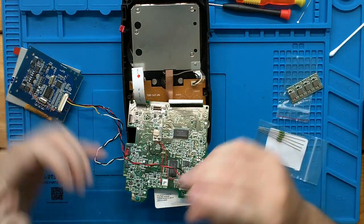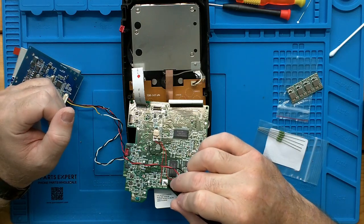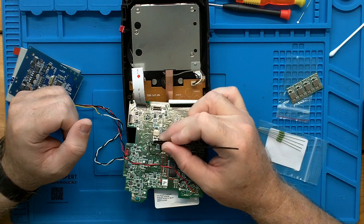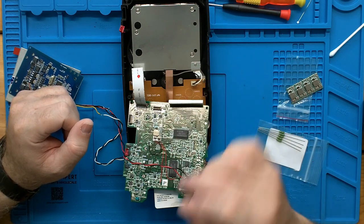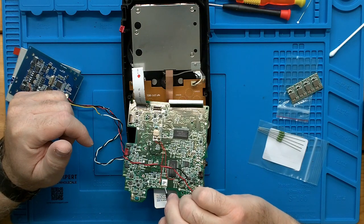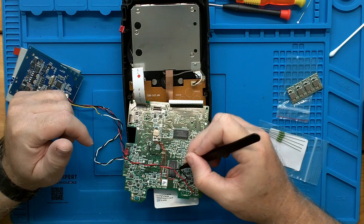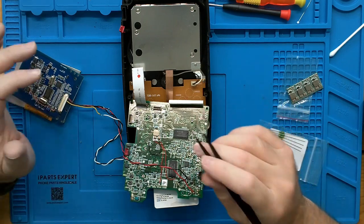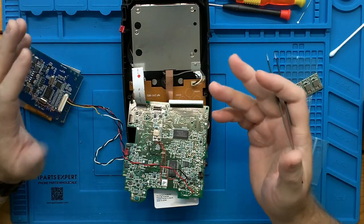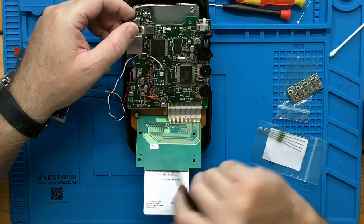We lifted the Zener diode and our large transistor off the board, previously, and we found a nice clean spot to mount the regulator to. I caught a ground off of the backside of this capacitor. The battery input comes from the original 5 volt circuit. And the voltage out feeds the 5 volt rail directly at one of our memory chips. So with that, when we put battery power on it, we were able to get the main processors to boot and we got sound from our game.